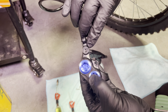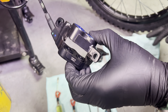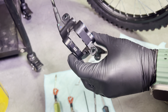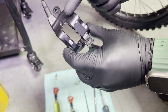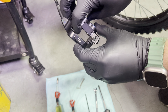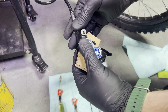On the outside you'll see there's a 3mm bleed port. This is a much bigger brake than any of the previous brakes, so there's no way to stick a little yellow bleed block in here. So I do have a little piece of cardboard I'm going to wedge in here — that's just going to keep the pistons from falling out. If you're bleeding this and squeezing the lever, these pistons may move in a little bit, and you just don't want them to fall all the way out.